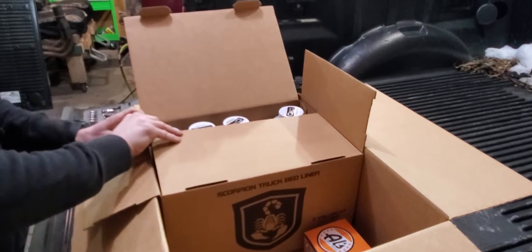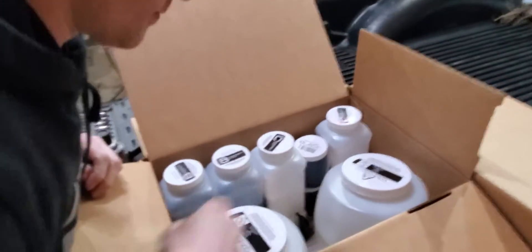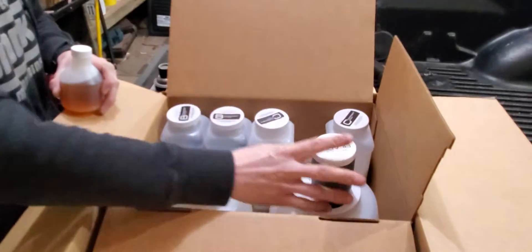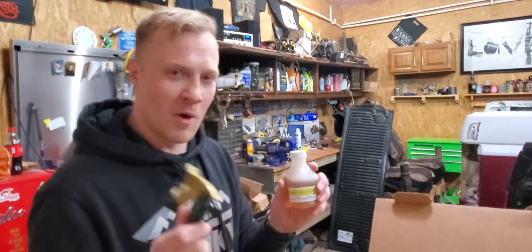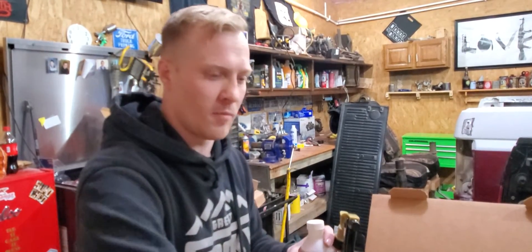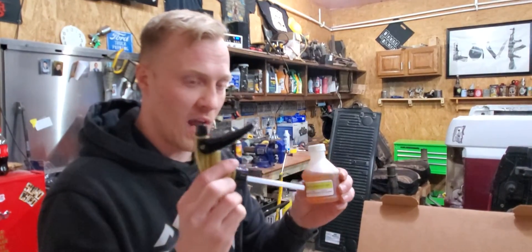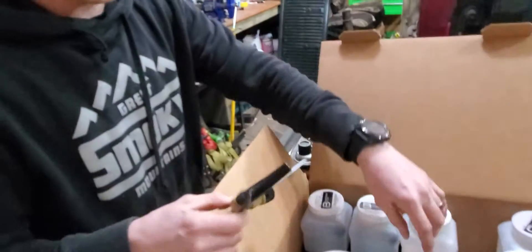This is their two-gallon kit. In their two-gallon kit, they've got components A, B, and C. This is your regular black toner that goes in the paint — that's what gives you your black bed liner. And then you have your super tiny fun-size adhesion promoter. This basically sprays down after you get done prepping everything, so you get a nice, hard, tight bond with your material to the actual truck or whatever else you're spraying on. Must-have — very must-have. And also more instructions at the very bottom. Man, this stuff is super cold.